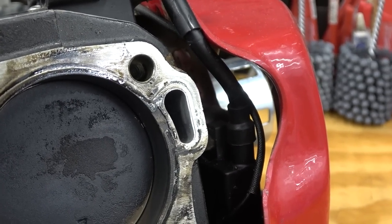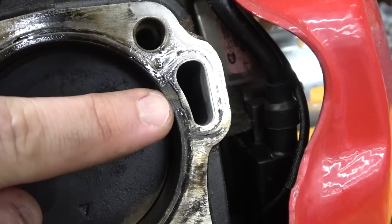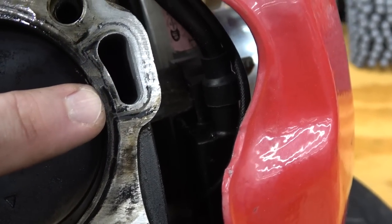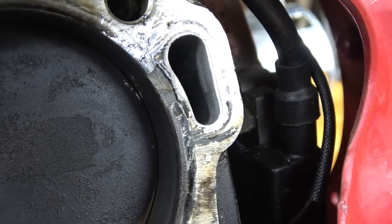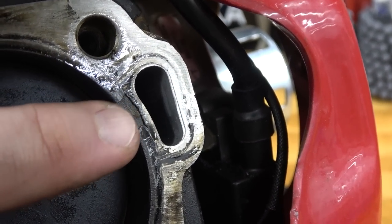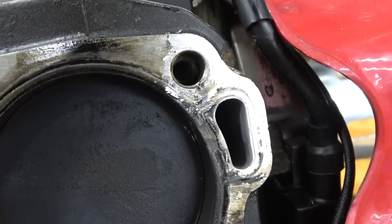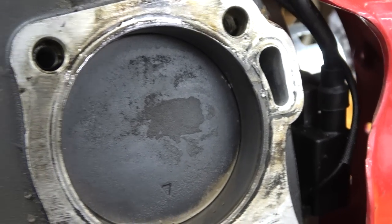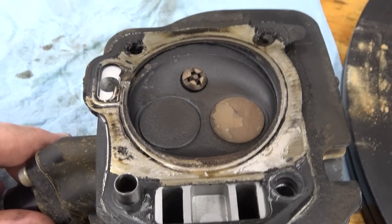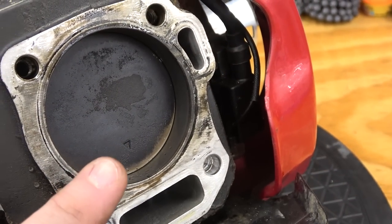What's interesting is the block seems to be cracked right here — the block busted pieces of it off. I've never seen that happen before. It flaked part of the aluminum top layer off. So unfortunately that's not going to be fixable. I mean, we could try to risk it and put a head gasket on it, but I don't think it's going to work out. Look at how warped that head gasket was from this — I would say the block failed is what seems like happened.